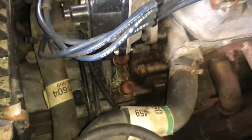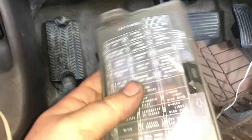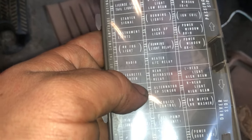The D4 light is flashing. Before you get into any of this — whether you have all those codes or some of those codes — the very first thing you want to do is go to your inside fuse box right here. There's a little cover, and you want fuse number 15: alternator/SP sensor.